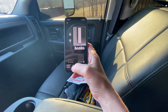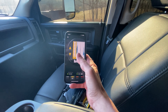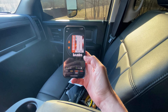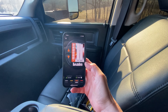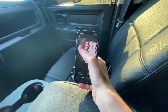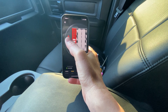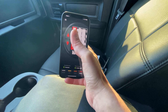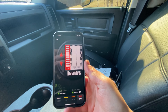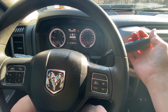With this app you can choose stock — which takes it back to stock — city mode which is probably more for fuel economy where you can set throttle up and down, sport which will be a little more sensitive and faster, and then track which is probably going to be the fastest. Use your up arrow to move sensitivity up or down. So on track all the way up, that's going to be the fastest response. Let's go ahead and put it in drive and see what it's like.